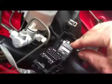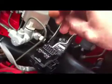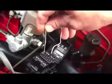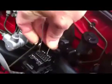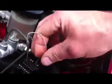You can use a paper clip. If you look on here you'll see pin 10 on the right and then there's ground on another one - just a little white square. We're gonna hook those two together. Now we're gonna read the timing. My timing right now is at 13 to 14 degrees before top dead center, which means I'm gonna have to crank it back in order to meet the emission test.